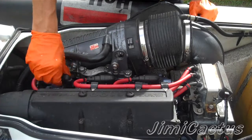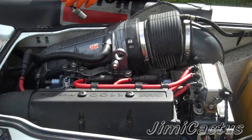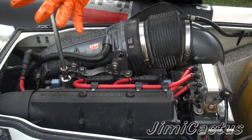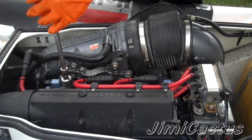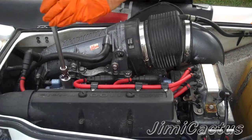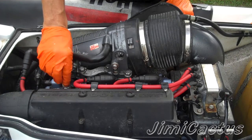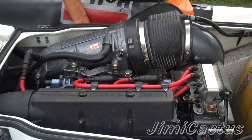For the last one, a nice easy twist back and forth with gentle pressure upwards and she comes off. Here's a good trick called snapping — it ensures you get the plug out without the top breaking off or the thread stripping. Give it a snap to loosen it, then a few cranks, and finish by hand so you have less chance of dropping that dirty plug inside the engine.